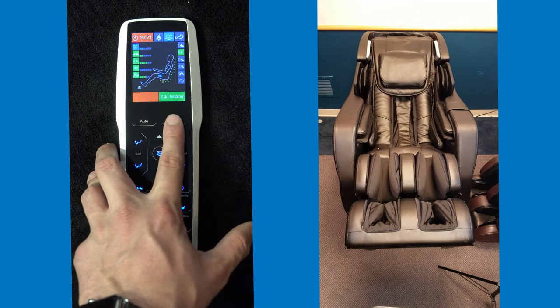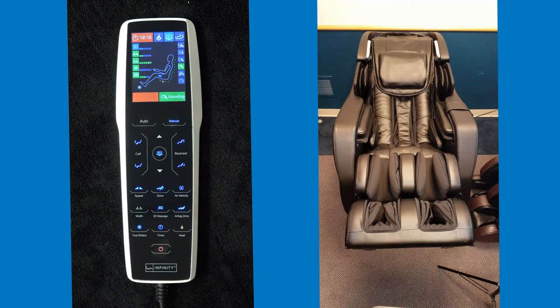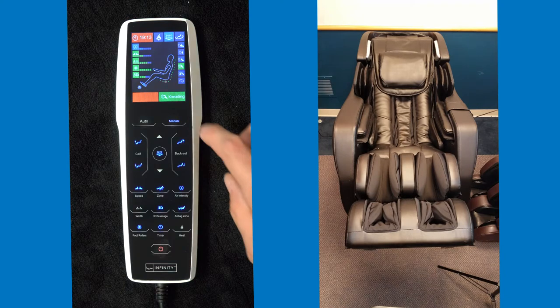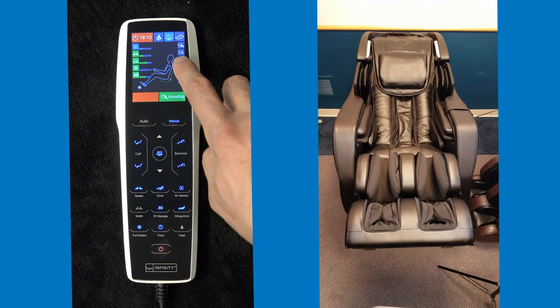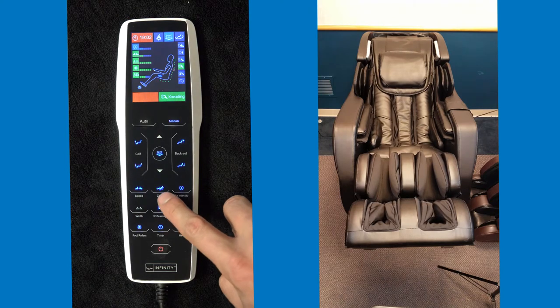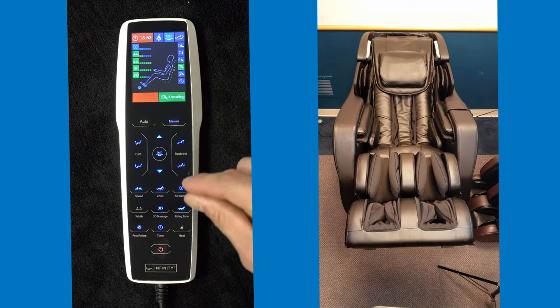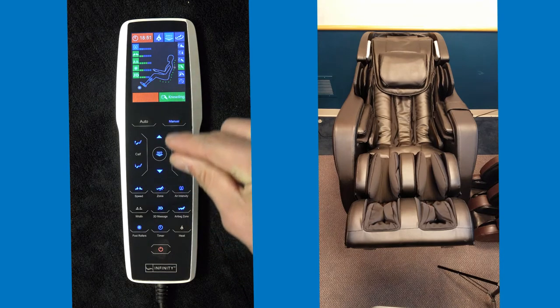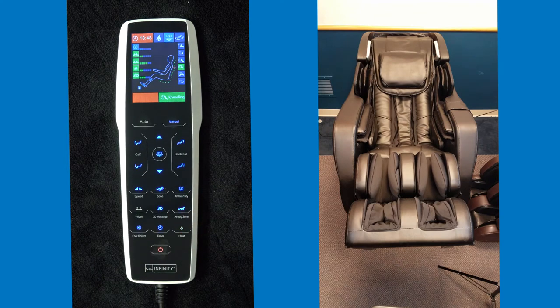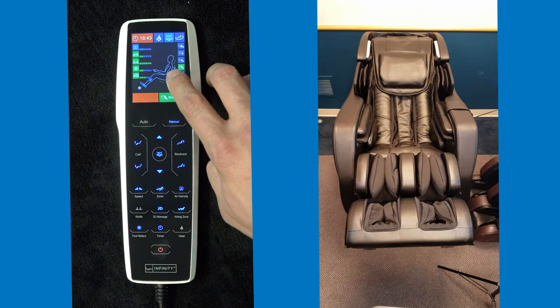I normally like to go down to the kneading massage to customize it for a customer while they're in the chair. Once you have it in kneading, you'll see the rollers are currently moving up and down the track, shown by the little red dot moving on screen. To customize and pinpoint an area, hit the zone button. Hitting it once lights up the arrows and puts the rollers in a back-and-forth range of about six to eight inches. Hitting it one more time stops the rollers completely — you can see the red dot is no longer moving.